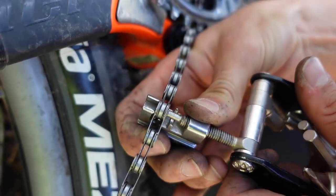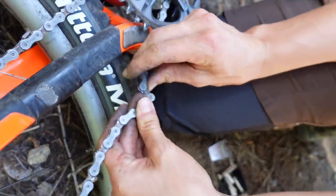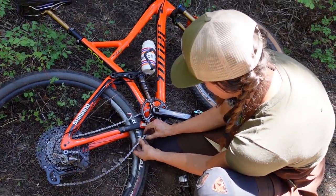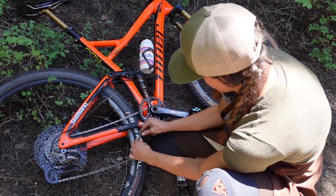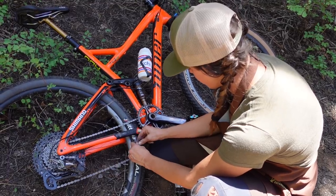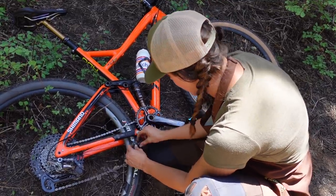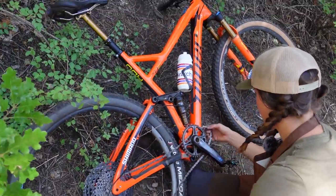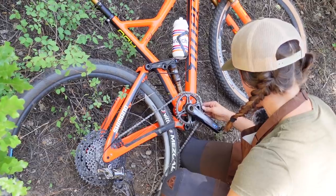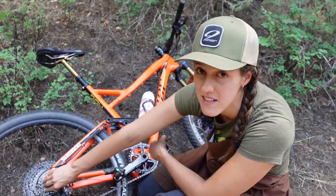Go a little further to get flush. If the link feels very stiff, wiggle it side to side to get that play back in — otherwise there'll be a big clonk every time it needs to bend going over the top. Pop this back on the chainring, being conscious of the narrow-wide situation. The final step is to put your clutch back on and ride away.